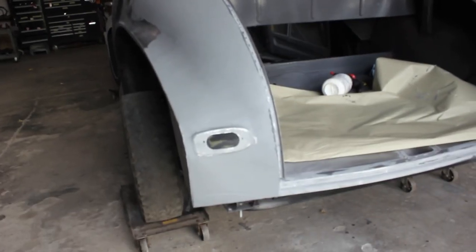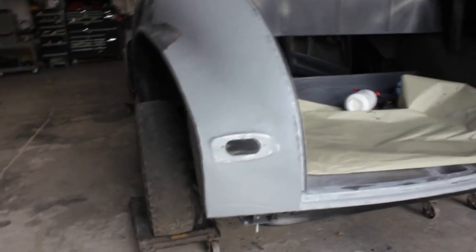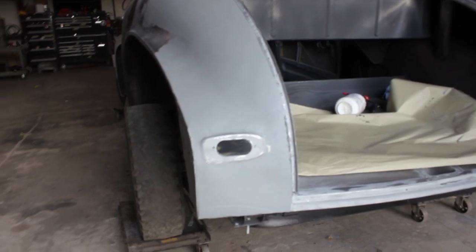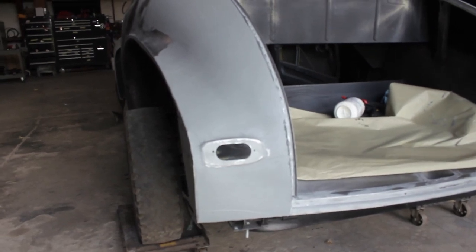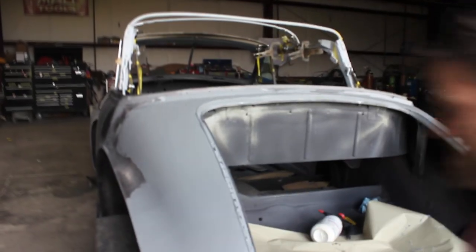We got out of here early this morning, around 4:35. I finished sanding on the back and everything, cleaned everything up, and did a final spread. This is all the same areas lead would go if I was doing lead. This is a high grade epoxy binder and it is to replace the lead — it will not shrink.